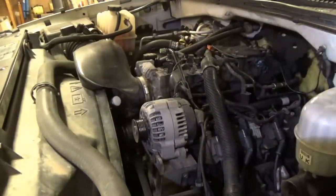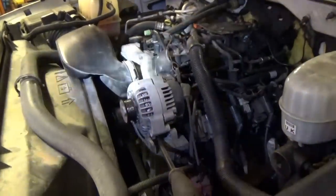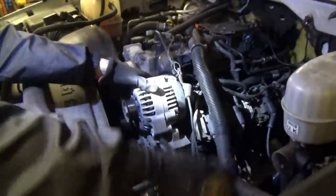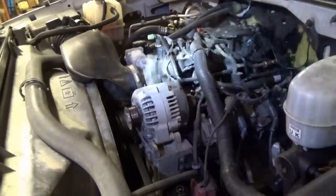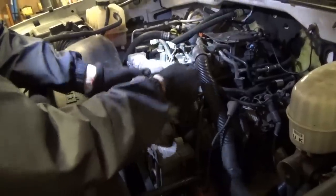I'll leave that on there so we can put the belt back on. Now before touching the alternator, obviously we want to disconnect the negative battery cable. They look a little rusty — we'll spray it down with some stuff. We've got to unhook our positive post too. Now we can get it out of here — she'll come right out. Bingo! Here she is, probably the original unit.